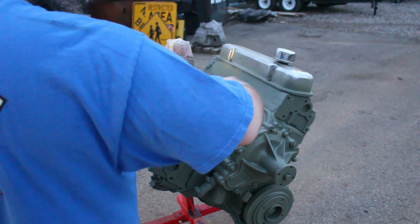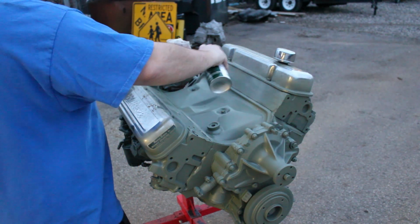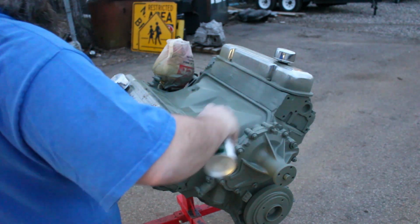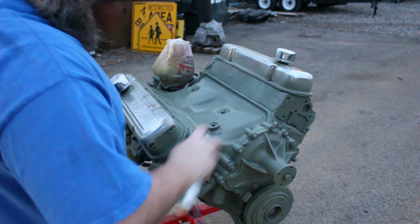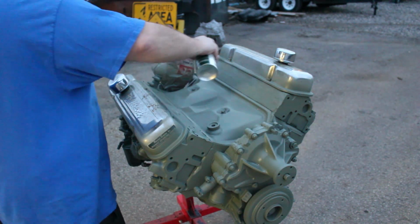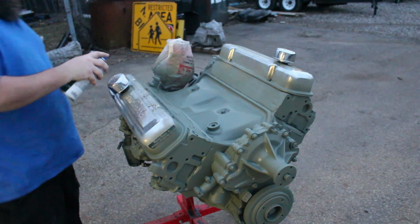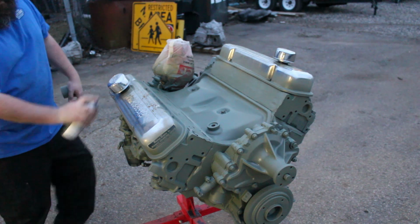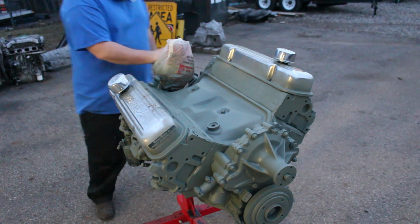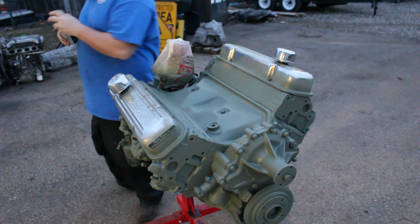All right, I cashed out this can, laying one more little coat down here on the belly pan, and let this flash for a little bit. We want it to get not wet, but slightly dry and still tacky. Once it's at that phase, we're going to lay down our light blue metallic Pontiac. That's it. Can number 3 cashed out.